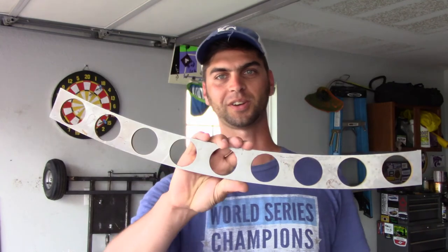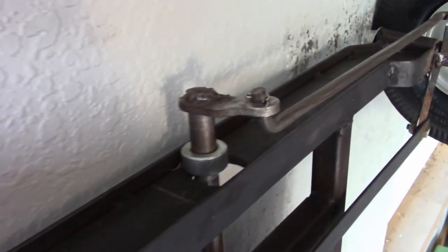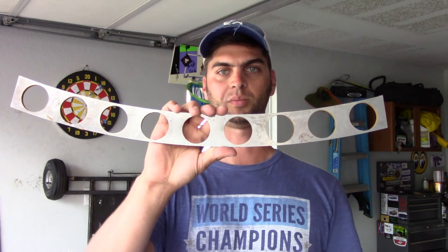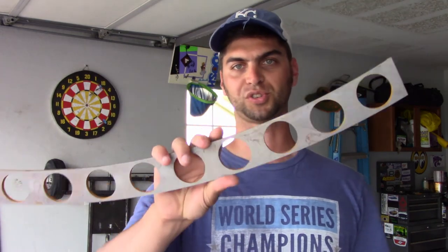Greg was able to hook me up with this — it's going to be my new front axle for the rat rod radio flyer. I'm going to do similar to the current design: weld a top and bottom flange to it to make it look like an I-beam profile. As you can see it's got a nice bowed shape to it, and it's about quarter inch steel — everything so nice and crisp. For the top and bottom flanges I'll use similar material, drill holes probably every inch or half inch in a clean repetitious pattern, then plug weld that with the TIG welder.